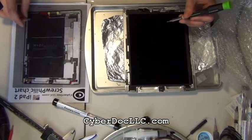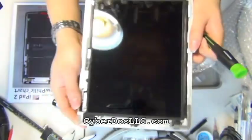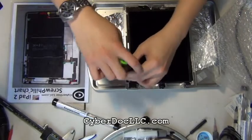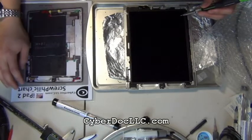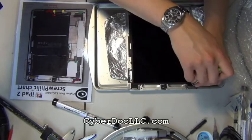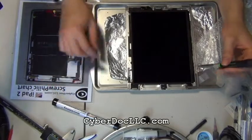Because iPad 3 and iPad 4 has a retina screen, it actually has two separate backlight tracks. So what usually happens is you only have half of the screen that's dimmed in iPad 3 and 4. As you can see, this is the common symptom from iPad 2 dimmed screen — when the iPad backlight tracks on the logic board are bad, meaning you accidentally fried it when you changed the screen. You get no backlight but you still see image and the iPad works just fine. It syncs to iTunes and you can see a little dimmed image in strong light.